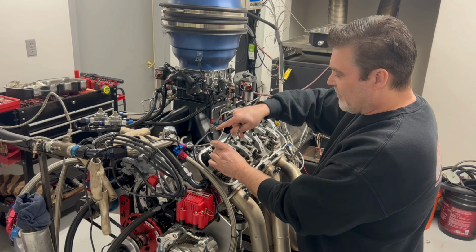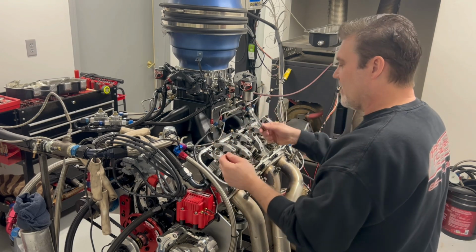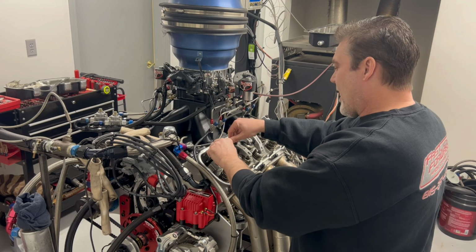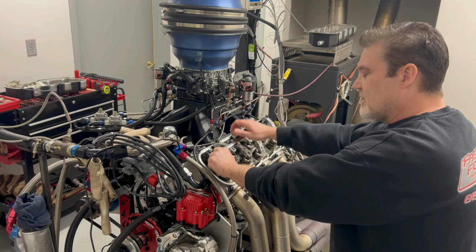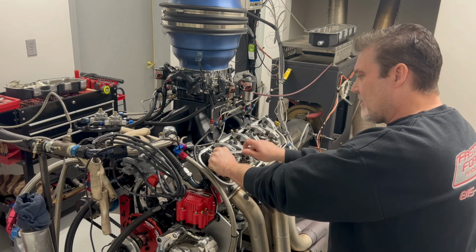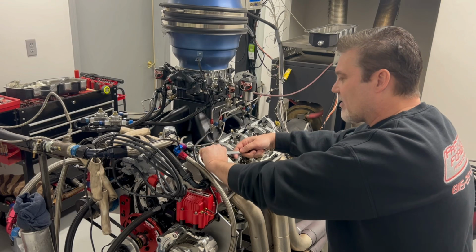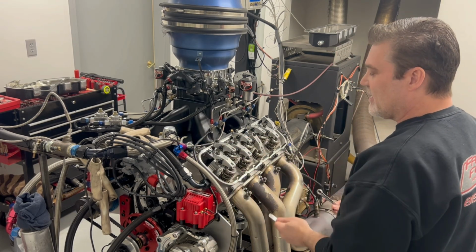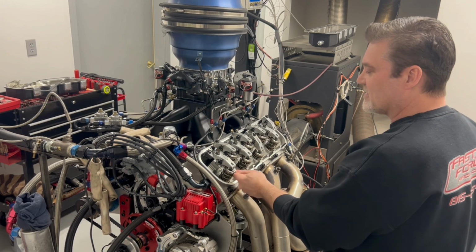Okay, I'll run this adjuster nut back down, and really, the trick here, I don't even call it a trick, it's just more of a feel thing. To adjust this right, I'll put the Allen wrench on there, and the wrench. I'll give the wrench just a quick pull like this, and then together with the Allen wrench and the wrench, I'll give it one more turn, like that.